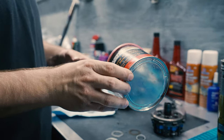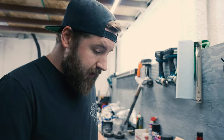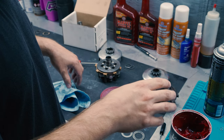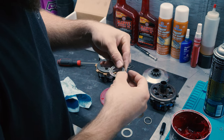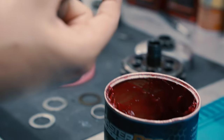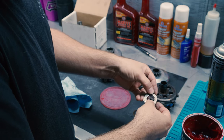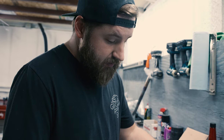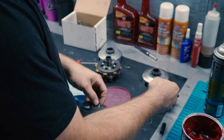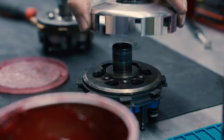When putting it back together, I use red bearing grease. Everyone's got their opinion on that, but I use red bearing grease — I think the other stuff just melts off. On the bearing, I put just a tiny bit — I mean a little bit. I'll put like two little tiny dabs of it. I've had this jar for probably five years and I'm still going through it. Once you've sandwiched these and put them back on the clutch and they spin around a few times, all this grease will eventually circulate all the way around and it'll be even. The main thing is to put the orientation of the washers back on correctly — the thick one, the bearing, and then the other washer on top. That keeps the driver up off so it'll spin smoothly.